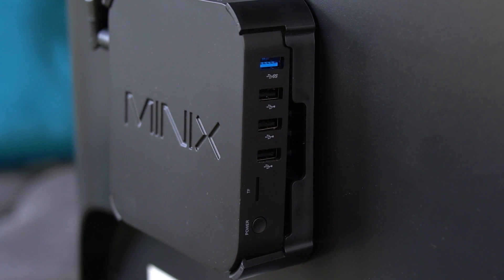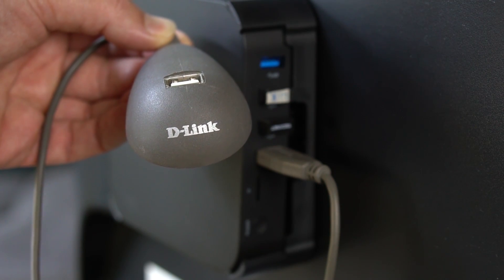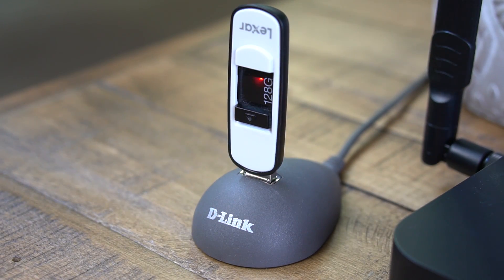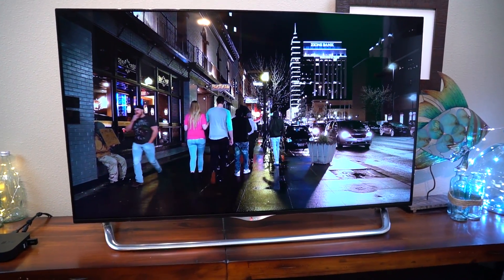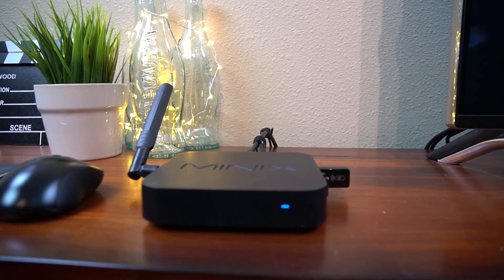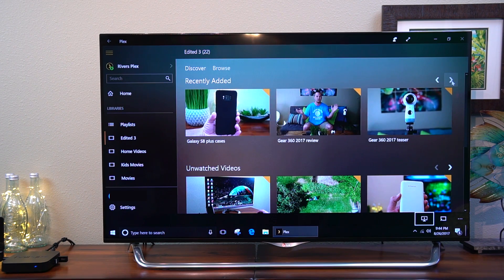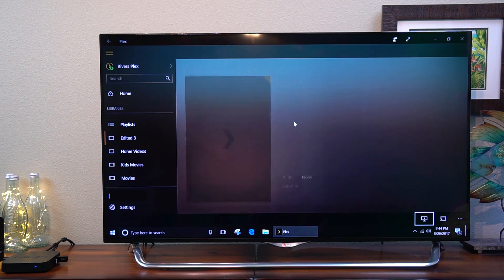You're going to have plenty of room if you need to add USB devices, and if you have it mounted on the back and you want to have a port up front, I use a little extension cable so I can plug in a thumb drive or maybe a USB external hard drive and it works great. The Z834 Pro also works well as a media player. I tested it in Kodi and my favorite app, Plex, and it worked really well. Using Plex I could stream up to 4K, but when I went up to 4K at 60 frames per second, that was too much data and it couldn't keep up.